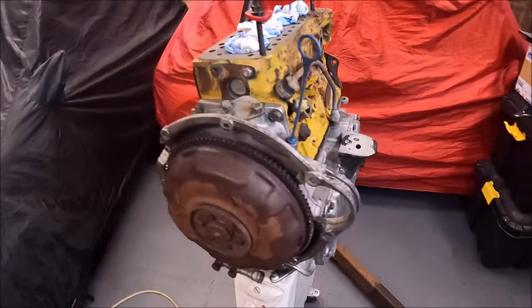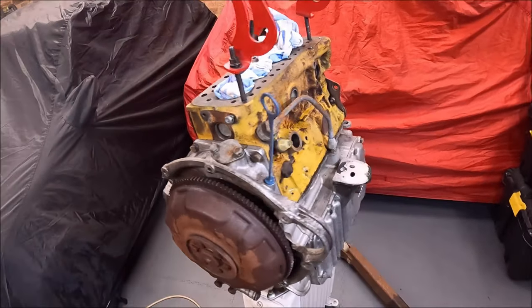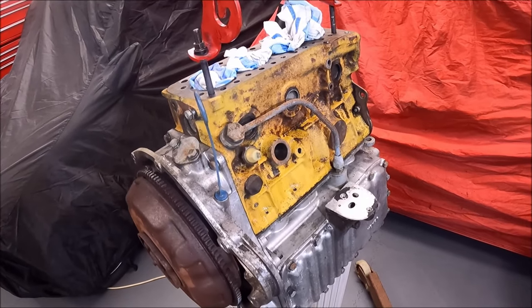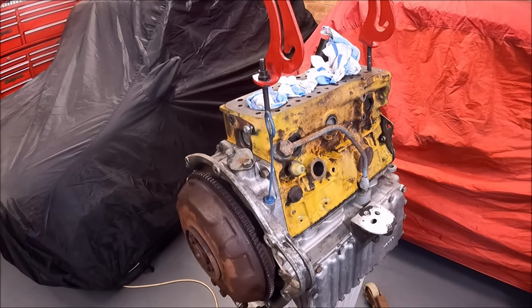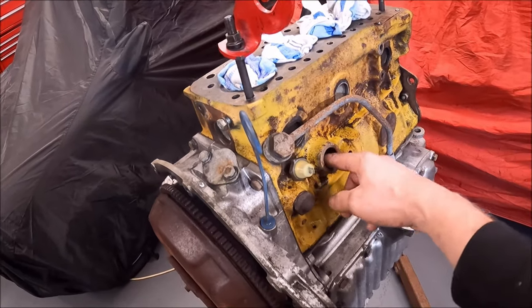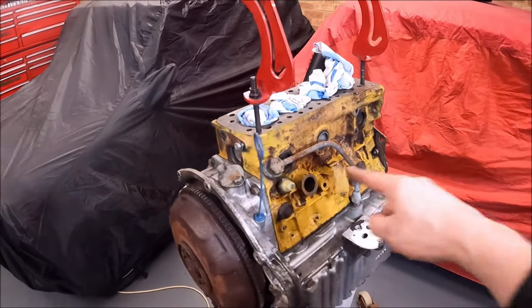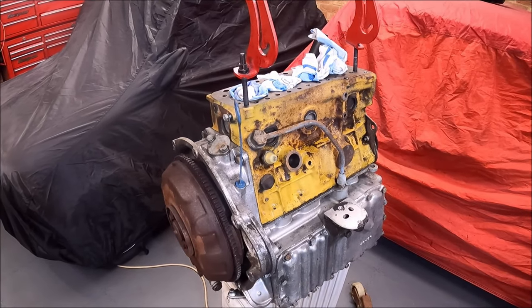I can put it in a container and then dispose of it at the tip in the proper oil waste disposal. So that's good. I've got the heater below the engine at the moment. I'll be in the garage for another hour, so while I'm here, I've got the heater on anyway, I might as well allow the heater to dry out this engine. An important thing to do is I've replaced all these rags. The rags where I had them covering holes, I've either taken them out or replaced them with dry ones, because you do not want to leave wet rags inside the pots or the bores or anywhere else for that matter. So however you're going to do it, at the end, dry it off and clean the rags off.